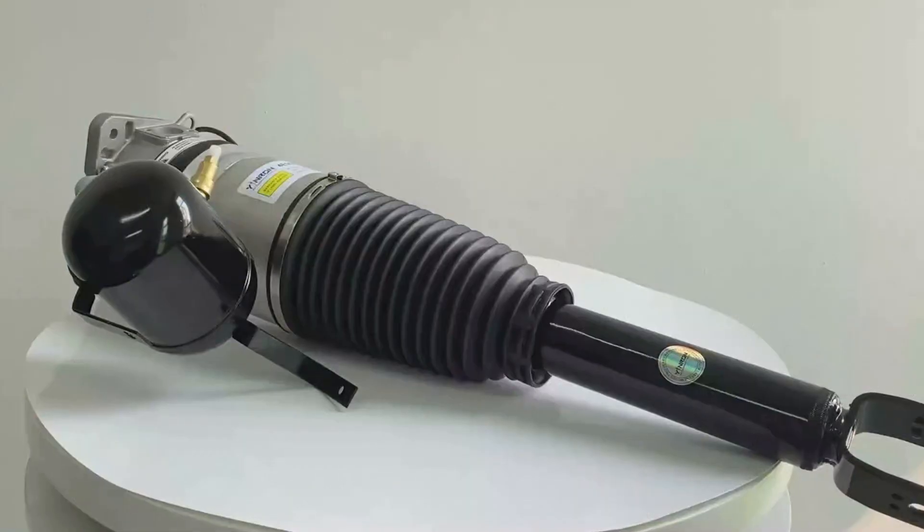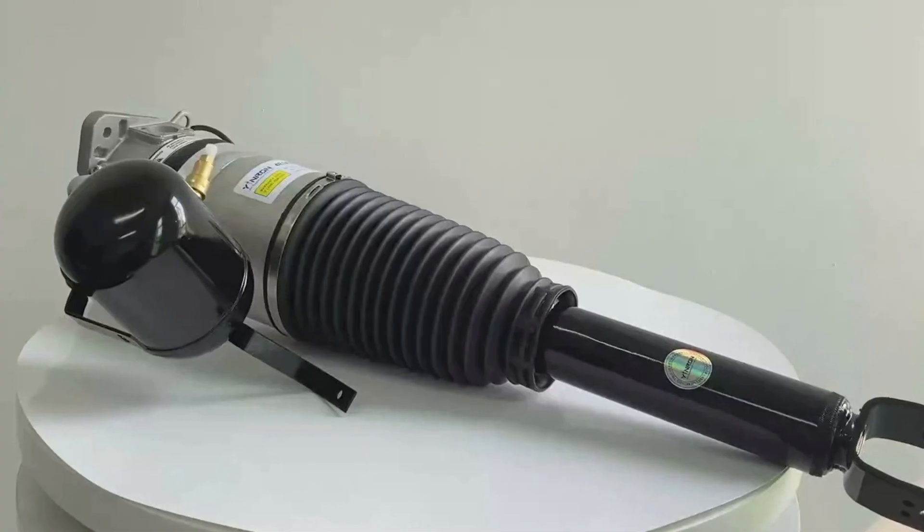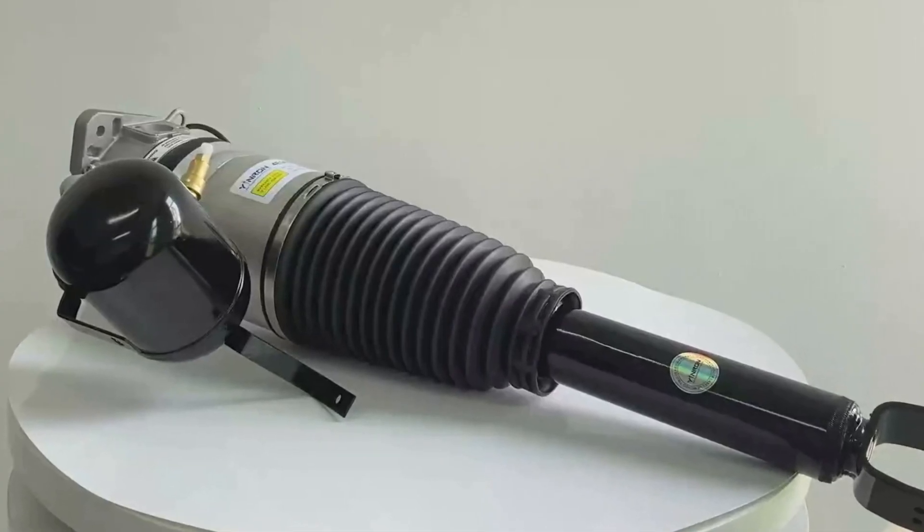Other than that, after the Audi vehicle reaches about a decade of age, the air strut seals start losing their shape and one of the struts may start leaking. If this is the case you will need a new strut, but this is anyway not a DIY repair.